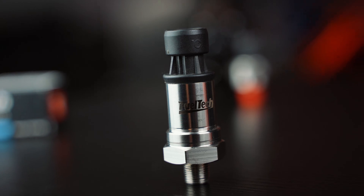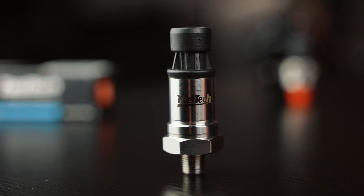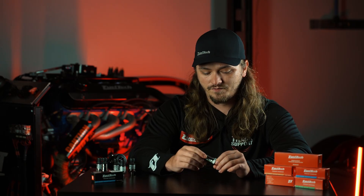The next one is our 10-bar MAP sensor. It reads almost 15 PSI of vacuum and up to 135 pounds of boost, so it's for something with really big boost — when you'd top out the seven-bar MAP sensor in the ECU. You usually see this on really big boost outlaw turbo cars or tractor pulling applications.